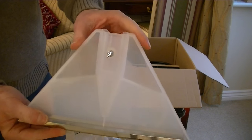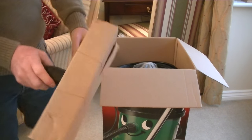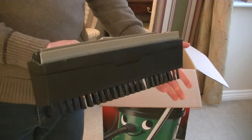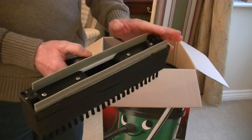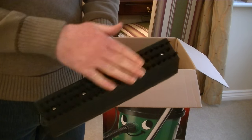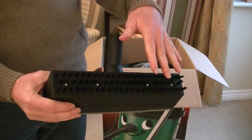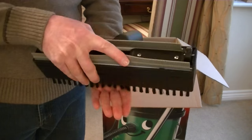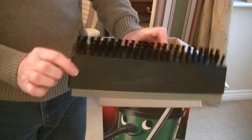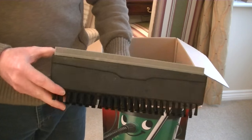It screws onto the tube — you have to tighten the little screw thread. So that's your main carpet washing nozzle. Here is the hard floor washing nozzle. Although not as convenient as a Vax FloorMate, it does a very good job. It's got very stiff brushes — not for use on delicate floors, but great for stone or ceramic with dirty grouting. You flip the nozzle over with two squeegees and suck the dirty water into George, leaving your floor fairly dry.